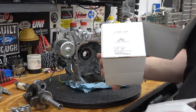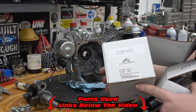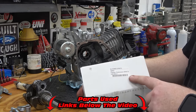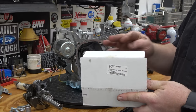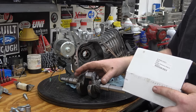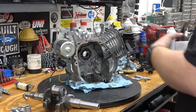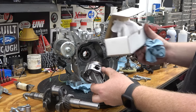We tested the parts and it's going to use a Go Power Sports Fire 265 non-HEMI cam. It's a HEMI head but it uses a non-HEMI style cam. For the rod, it'll use a Go Power Sports 6254 — this is a Predator rod because HEMI and non-HEMI Predators take the same rod, but GX200s are different. That difference is about 5 to 10 thousandths on the crankshaft journal size. The only thing left to check is wrist pin size, since this has a HEMI-style piston and we need to confirm the wrist pin fits the billet rod.